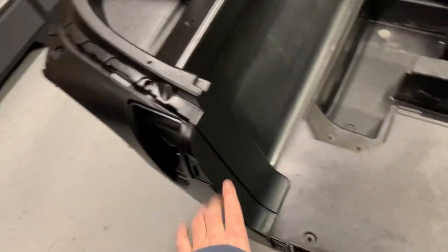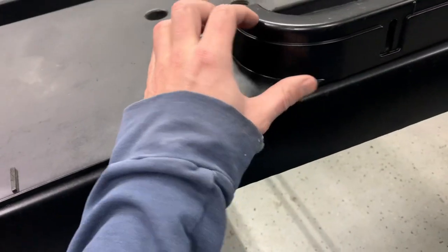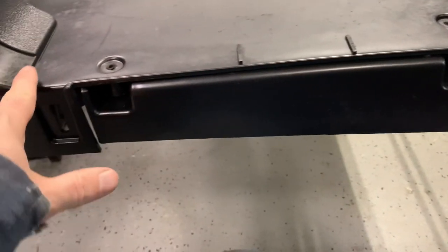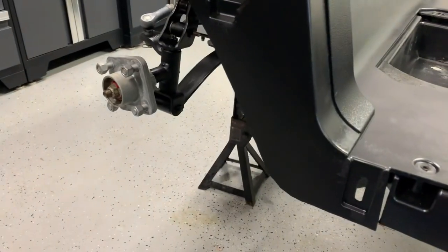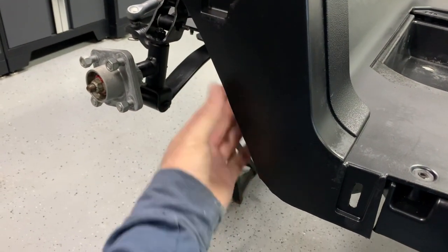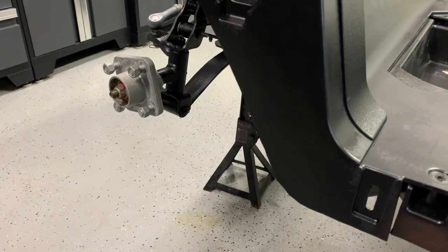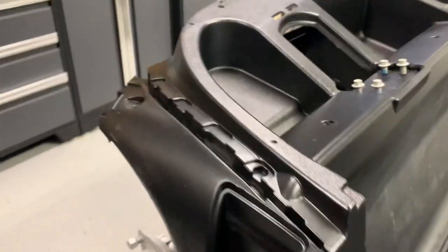I like these to look really good. There's a little bit of exposure too when you get them back together — sometimes the rocker covers most of this, but if you take the floor up you can see a little bit. So I like to spray this guy down too since it's exposed — the mat doesn't come all the way out here. On the previous one there was a big chunk out of this, so I put a little bit of material here just to cover that and have support for the body.